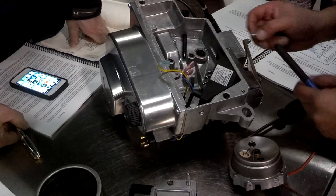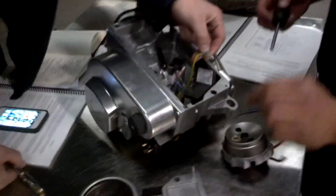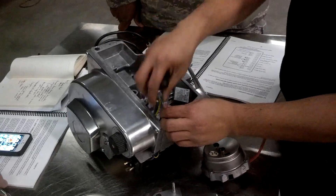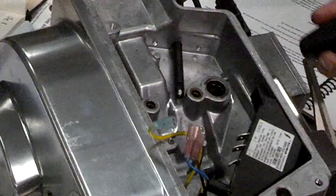That's what happened to us. So again, the transformer is grounded — I think that's what Austin was looking at. It's actually grounded to the chassis, or to the lower fan house of the Airtronic burner, so that when you touch it, it doesn't shock you. It's grounded to itself.